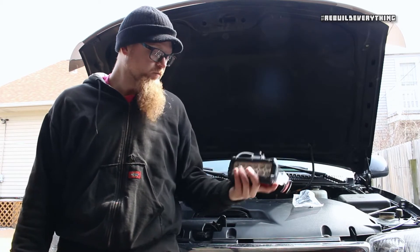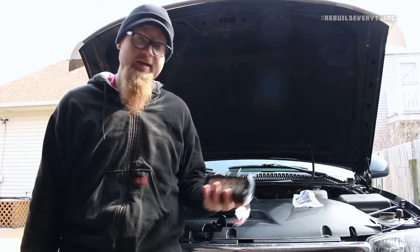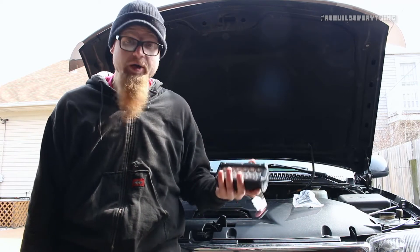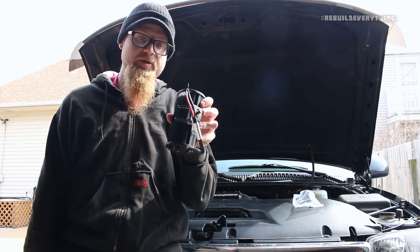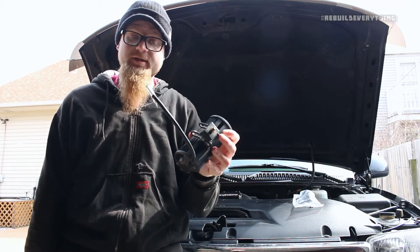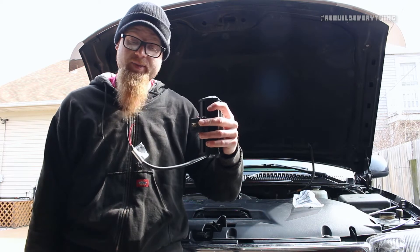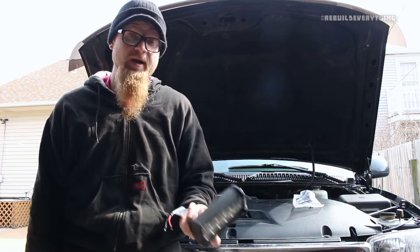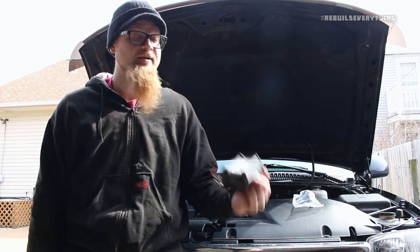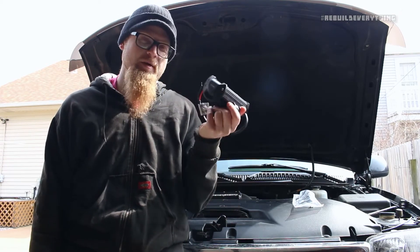Here is the old one first. The casing and stuff on it is still good. There is a little bit of salt speckle because it was mounted on the exterior of a Wisconsin truck. It is a positive and negative lead — just a simple two-wire hookup. Really decent gauge wire; I wasn't expecting much out of it. Usually these type of electronics don't have very good wire — it's usually super thin speaker wire. This stuff isn't the best, but it's not the worst. Maybe like a 14 or 12 gauge wire. The actual light output was solid on it, but it just stopped working. I had it on a couple 12-volt sources and it just failed. Nothing looks burned out, doesn't have an ozone-y smell.